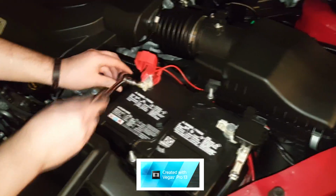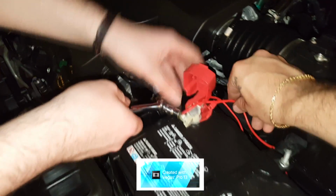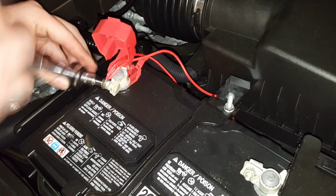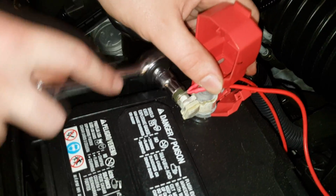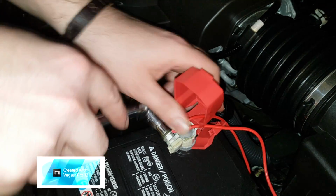Okay, so we're putting in the power source now. We've got both the high beam and the low beam ballast wiring right there, running it along the back. Instead of removing the stock nut and going under it, it's better to just add an additional one on top if you can.